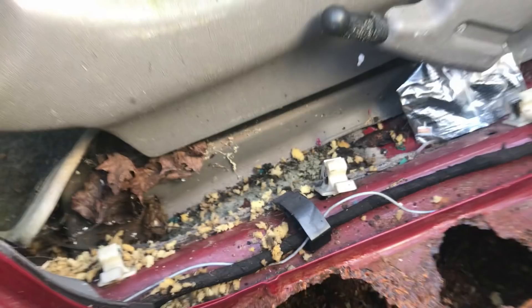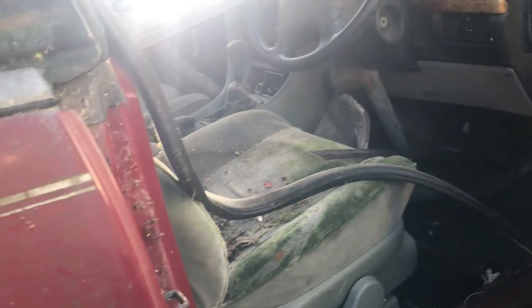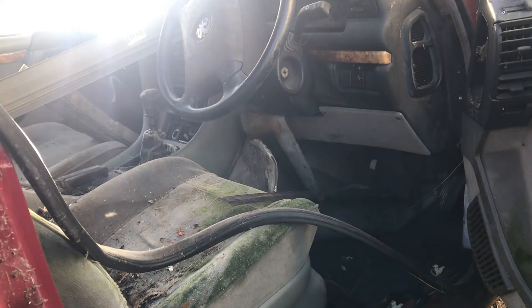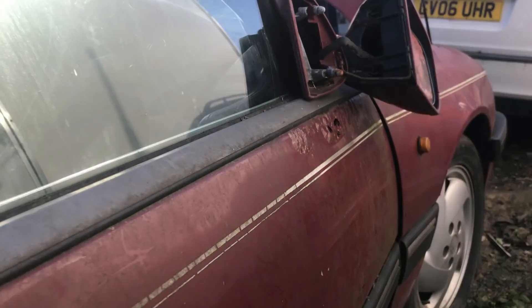It's a sunny day and I'm starting to feel a little bit more optimistic about this car. I still won't be able to make a full decision on its long-term future until I've actually committed to stripping it down to a shell, but if I had been really scared I would have just taken the engine and box out. I think I'll probably get it home, take the engine and box out, and then continue stripping it to see what it actually looks like with all the panels out of the way. I think these doors are going to be problematic — that lower skin has gone, and it's also gone up there too.